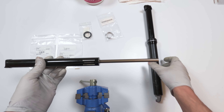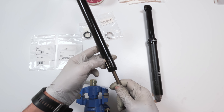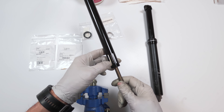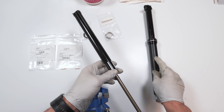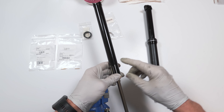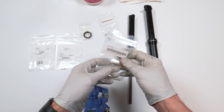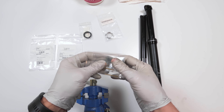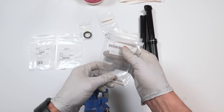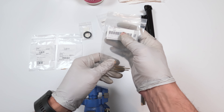Here's something you need to know: there's a brand new damper going to replace the one in here. KS changed their dampers — the guide pin slots are smaller. The one I'm taking out has taller guide pin slots. I didn't know that until after I bought new guide pins from Jensen. Those guys really don't help with returns, and at the end of it all these old-style pins will not work for me — they are too long.